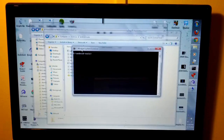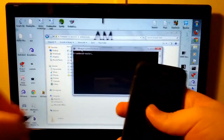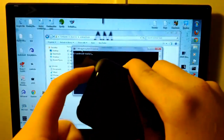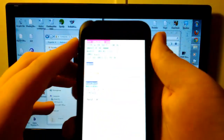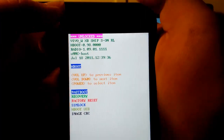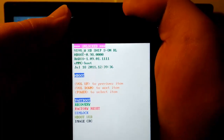You're going to want to take your phone. I'm going to take out my memory card because I have all the files, and we're going to put the memory card back in the phone. We're going to press and hold Volume Down and Power. Now, if you put that PG-32 IMG on your SD card, it's going to check and try to find that. But I took it off the root because I'm going to do that later, so I have it in my downloads folder.